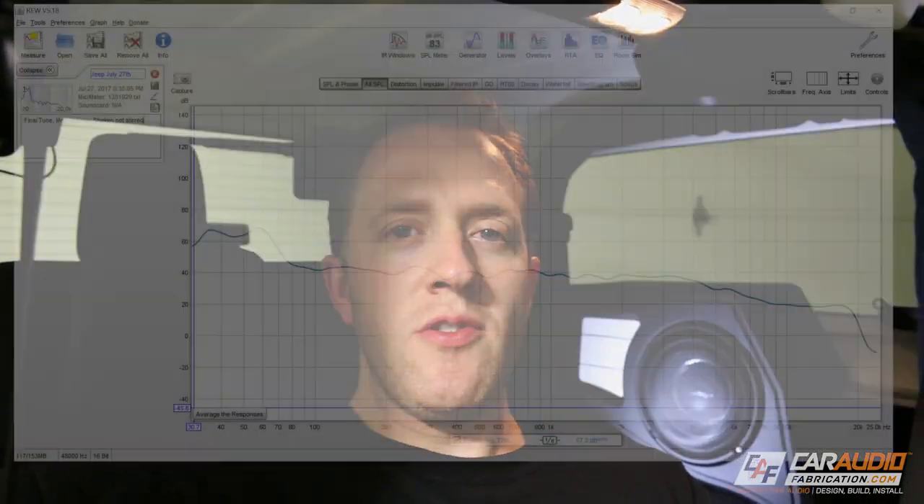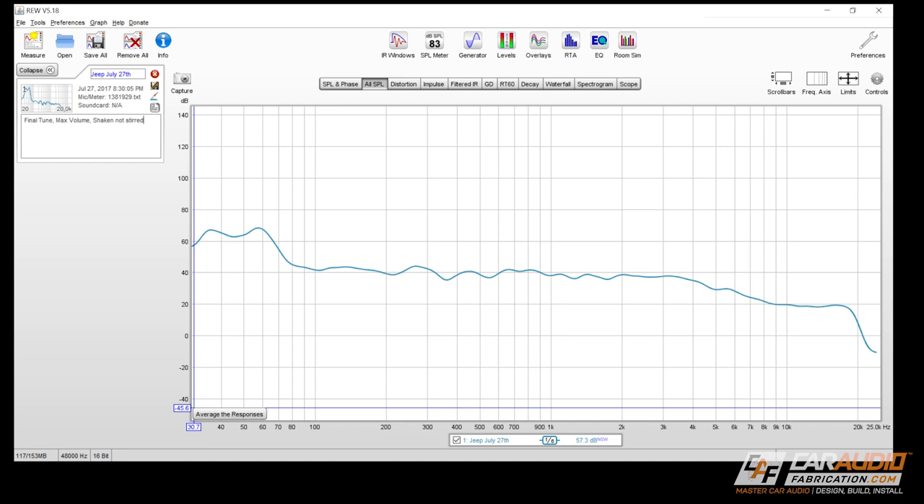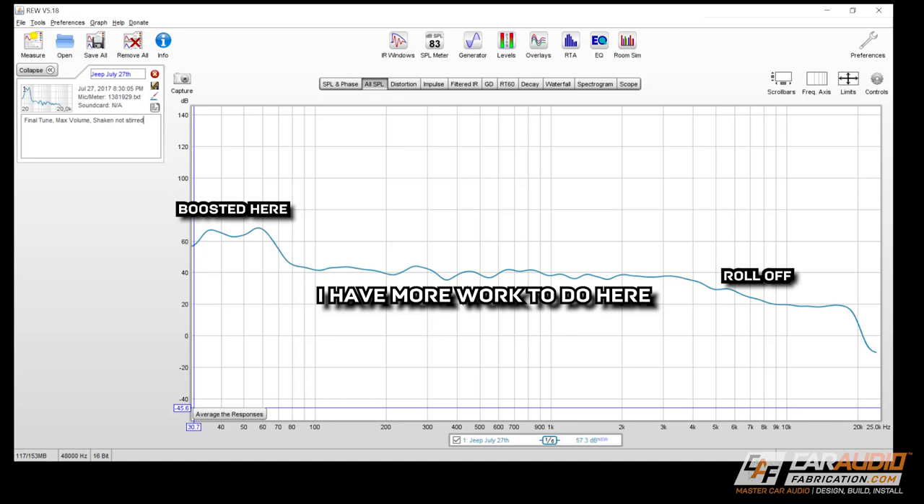I started off tuning with an RTA reading and was able to get this curve here. You'll notice the curve isn't completely flat — it's actually boosted a little bit in the bass region, and then everything above 3000 Hz or so I roll off. I did this intentionally because I do like a little bit more bass emphasis, and most people do. I also didn't want these tweeters to be piercing — because of their install location they're kind of sharp, but I was able to deal with that in tuning by rolling that upper end response off. I can't play songs you'd recognize because of copyright, so I have a series of copyright-free songs from different genres. Let's start with classical.